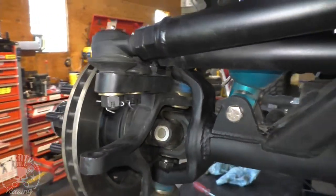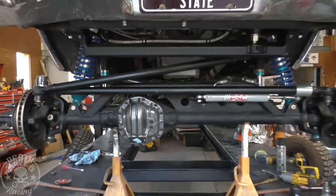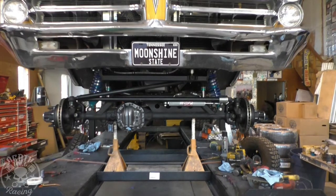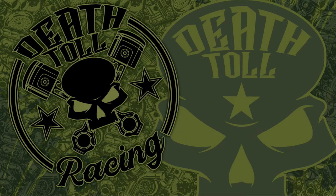I drained it out. And then you also, now that we have this thing pivoted up, the pinion up, I'm going to fill it to the upper hole on my front cover, and that would be technically for a high pinion diff, but that'll get the fluid levels to where my front pinion bearing will be in the oil again. So you're going to have to increase your oil capacity if you rotate the axle like we just did, so that pinion bearing is under oil.